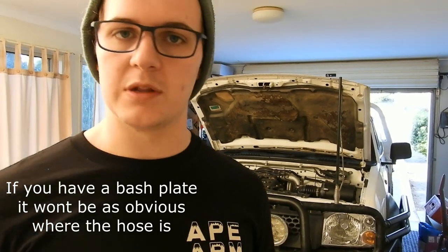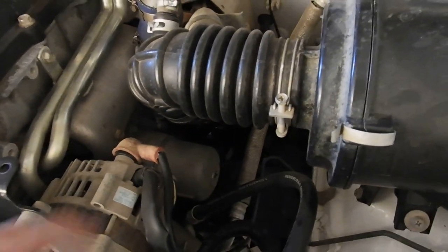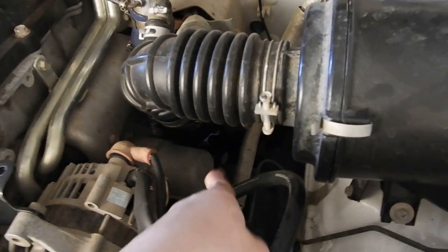But just always check, so just run some water into that drip pan first, make sure that it's coming out, and also, actually just put some water in there and map out where the oil is going to flow down. If you can't see the tube, just put some water down, see where it comes out, and put your bucket there so that you can catch it. Otherwise, you're just going to undo it and you're just going to pour some crap all over the floor, like I have.